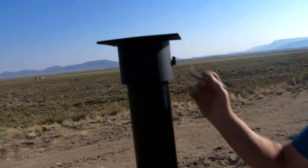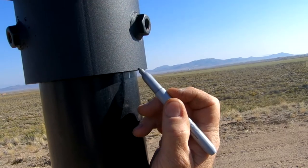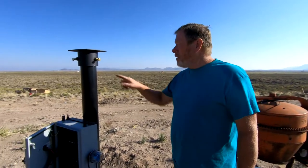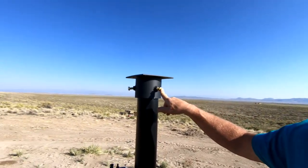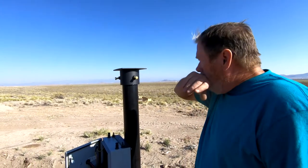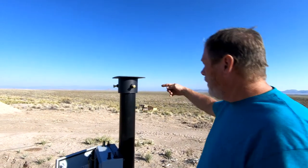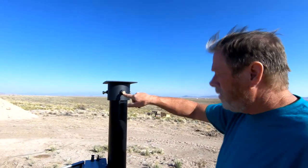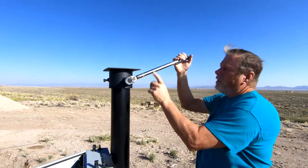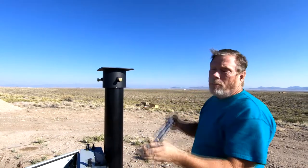We have to screw some bolts in here. I'm going to mark a line on this so that in case it gets moved, we can line it back up. The owner's manual says to torque these bolts at basically 24 foot-pounds. Torque is the amount of force required to turn an object around an axis — in this case at one foot away from the center of that object. So 24 foot-pounds means I have to use a force of 24 pounds against this bolt at a point one foot away from the center of the bolt. When I get there, this torque wrench will click and let me know I've applied the correct amount of force.